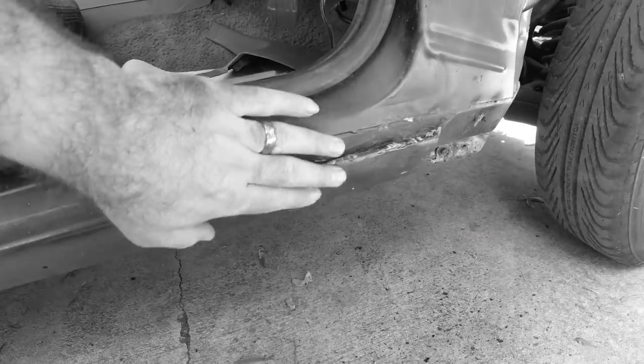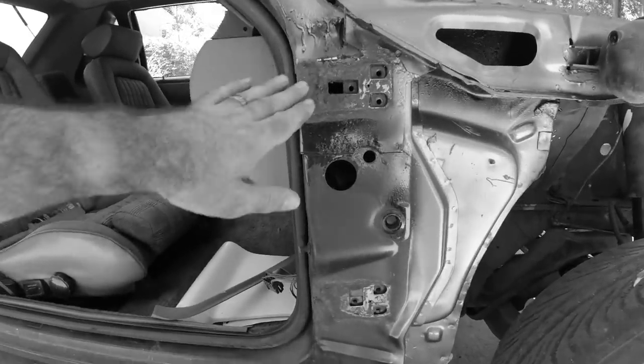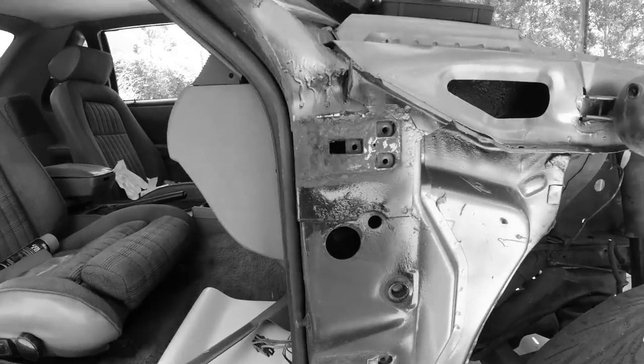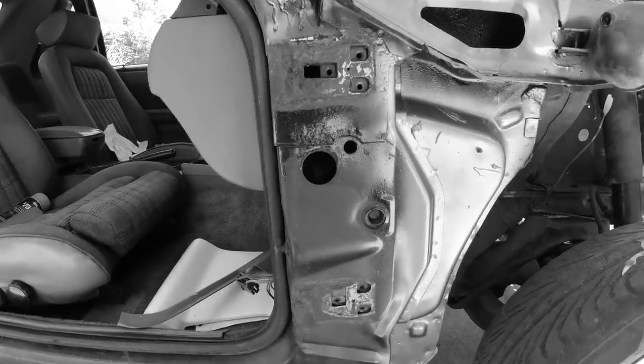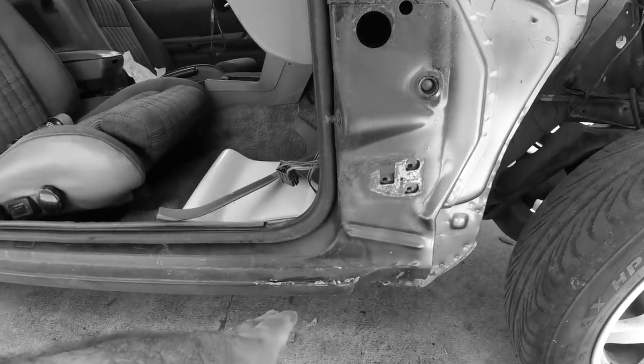I accidentally cut the camera off, so let me explain how I fixed the rocker panel: I just took that two-by-four, laid it on top of the rocker panel, hit it with a three-pound sledgehammer, and everything's good — we're flat now. Later in the video I'm going to come back, put some filler in, smooth it all out, and shoot some base coat on it. The body kit does fit. I may have to go back to Rogers and get another door — I'm going to take it back off and see if I can flatten it out; they may have just put too much bondo on the bottom. Hopefully next time you see the car it'll be on jack stands with the wheels off so we can really straighten everything out. It's going a little slower than I thought, but once we get all these panel adjustment issues out of the way it will pick up.